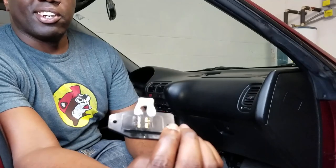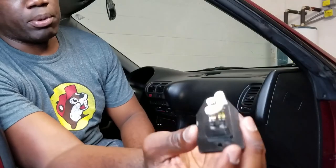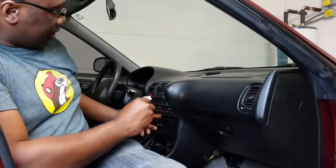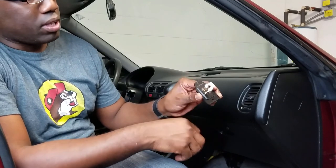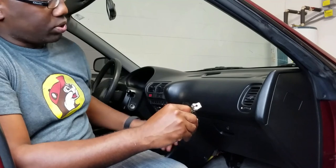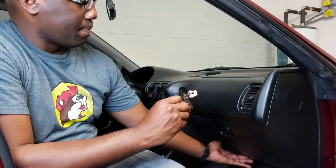It looks like some icing on a little sensor, and there's a plug on the back. As you can see, there are three resistors — all different lengths and sizes. The point of a resistor is to restrict the flow of current towards a circuit. In this case, we have the fan down here, and the fan completes the circuit. As it gets electricity, it's going to spin. As you select level one, two, three, or four, this lets the current go through one of these three resistors. So the longest one with the most resistance is for fan speed number one — that restricts the current going towards the fan and makes it spin slower. Less resistance would be number two, and even less resistance would be number three, which flows more current and lets the fan spin a lot faster.